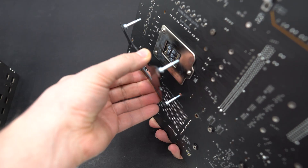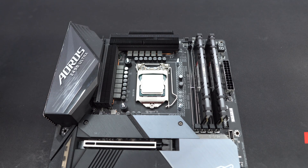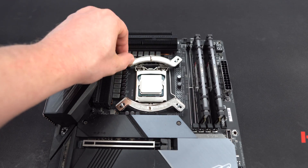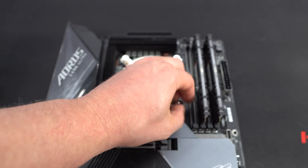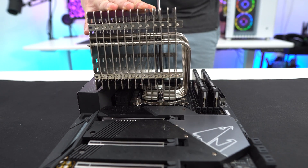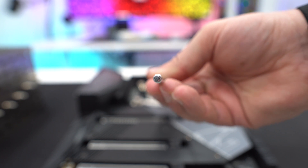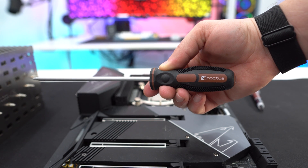For installation, we're using an Intel Z490 motherboard, and this process should be the same across LGA 1200, 1155, 1151, and 1150 sockets. First, place the backplate through the back of your motherboard using the holes around the CPU socket. Then install the black spacers and mounting bars, securing them with the included thumb screws. You can orient the mounting bars on the top and bottom or the sides of the socket. Apply the included thermal paste, place the cooler on top, line up the screws, and secure with the included screwdriver. Notably, Noctua used a Torx-style bolt rather than a normal screw, but at least they included the screwdriver.